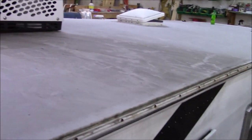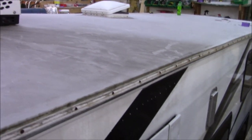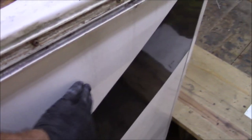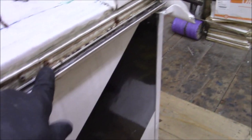When we get done with this, this is a 20-year roof system. You shouldn't have to put another roof on. You should be done with it, you know? But anyhow, we got some more delamination over here too. That shouldn't be, it should be solid. You can kind of hear that. You can hear that, that's hard. That's a thud. All these screws are all rusted.